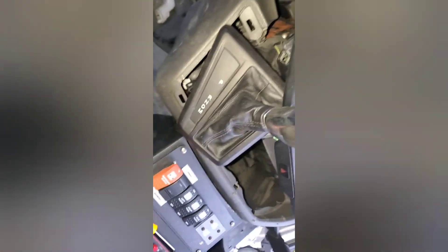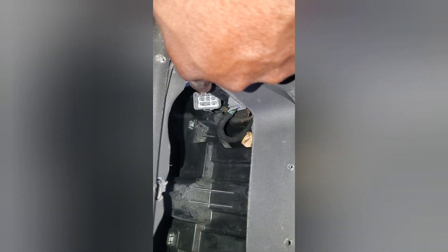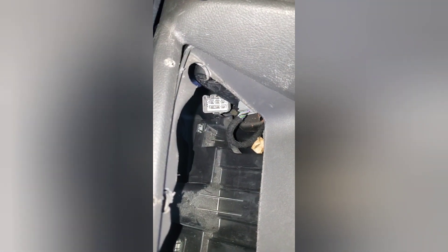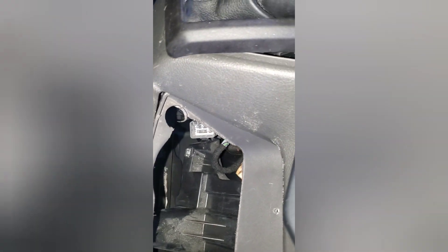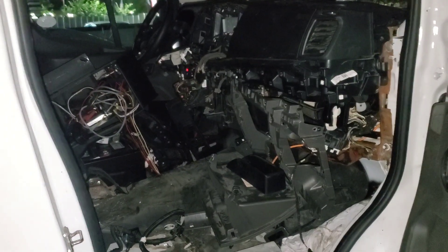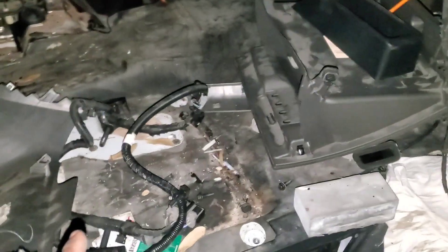Connected to the gateway and the blue and gray here — nothing. So there's one more junction left before we find the problem. It's going to be at the trailer brake control module. From the last video I think we saw the plug — I believe the trailer brake module is related to that connector right there. I'm about to dig a little and find out, but I believe this is where we're going to find the issue — something disconnected or whatever the case might be. It's a mess in here.